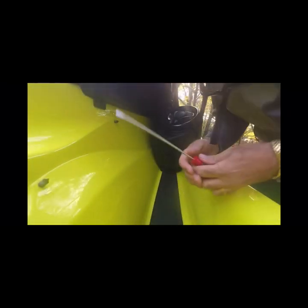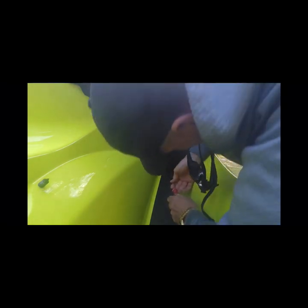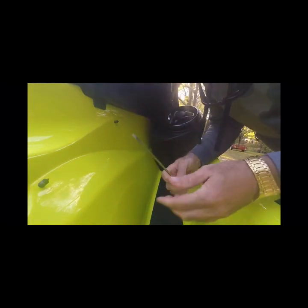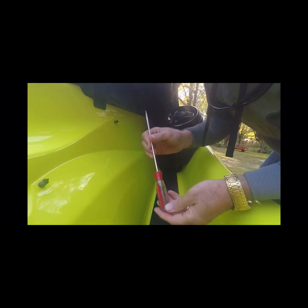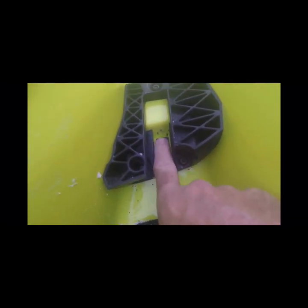The speakers have to come off first, before you can pull the last panel. You have one bolt at the top, and you have to use a long screwdriver — here is an 8-inch screwdriver. You have to pull it — there is a little hole at the bottom — you have to go in horizontally, and then once you have it in, leave the screwdriver in place. Then you have to wiggle the speaker side to side while pulling back. It does not come up; it has to go straight back to come off. And as you can see, you have that little clip where the screwdriver slides on and pushes down to get the speaker off.